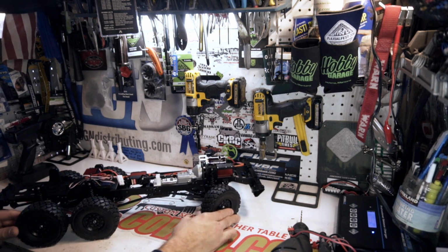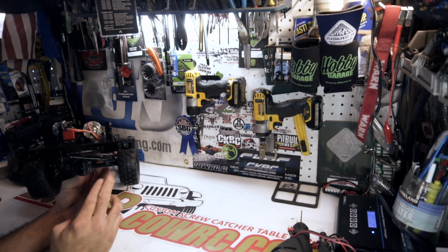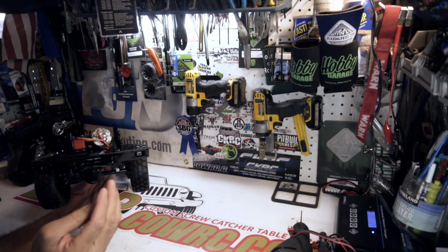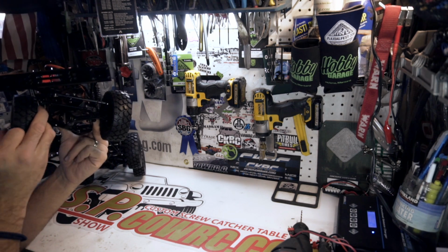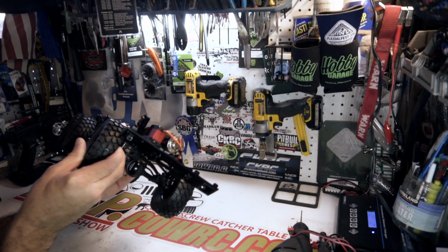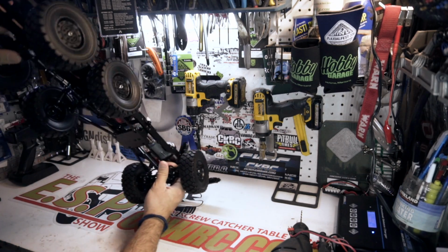I like the behind the axle steering is really nice. That is definitely something I like to see. That keeps the whole front of the axle nice and open and clear, so any rocks that come through and hit aren't going to bust any links. So it looks like you've got a drag link up front for the steering going down to your steering knuckles, and then you also have a panhard bar set up right here, because it appears to be, it is 3-linked.